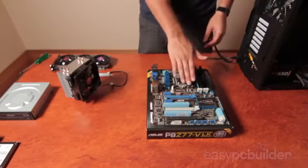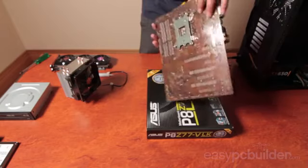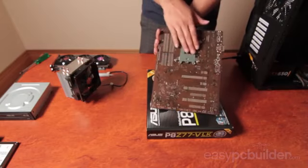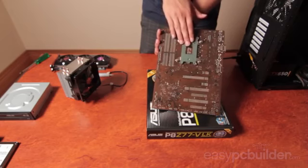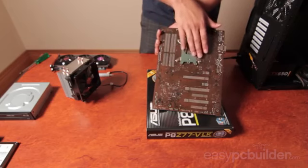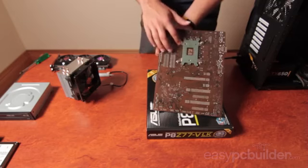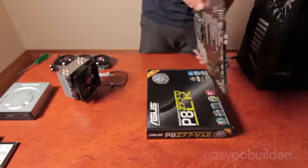So now that we've got our aftermarket CPU mounts installed, and on the back here we've got our backing plate. Now I should mention here that this backing here is actually an insulator. It's meant to be on there, so don't remove it. They're also on the underside of the other 4 mounts on the motherboard that you see here.